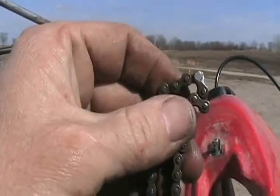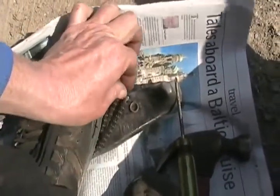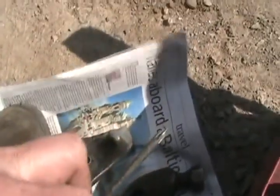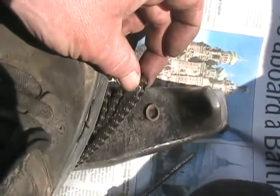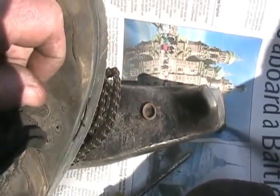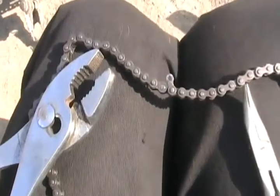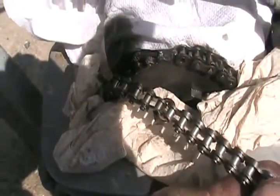Now I've done the same thing to the new chain. I've set the chain on that thick washer, just right across the opening. I just took the point of a screwdriver and a hammer and pounded the little pin until it's recessed. Now I just pry and swing that little figure-eight link over. Done - just used two pairs of pliers and moved it over by hand, no problem. Now just to separate the chain and tie it onto the old one with a little piece of wire. There's my little piece of wire to hook the two chains together, new and old. They're securely tied now.